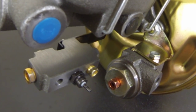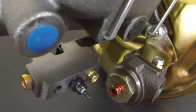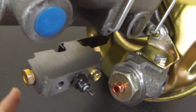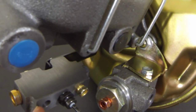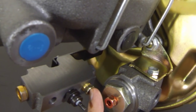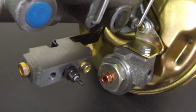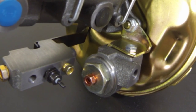This is a stock distribution block and metering block from a 67 to 69 Camaro and Firebird. The distribution block is the square cast iron block on the left side. It has a 1/2x20 port in the front and the rear, 3/8x24 on the two side ports, and 7/16x24 on the one rear port. The metering block, which is this acorn-shaped valve, has a 7/16x24 on the front hexagonal shape and also 7/16x24 out of the side.